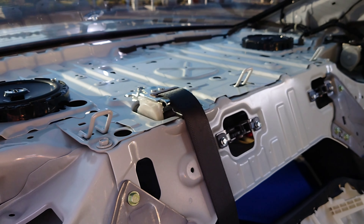I already showed you this in the first video — I bought this and use it as a glue. I apply it where the speaker is gonna lay down, then add more extra on top of the speaker. It's like a liquid rubber that gets really sticky and holds really strong. I'm gonna apply it on both brackets, add extra on top, wait for it to dry, then also add a little bit on this side where the speakers were. Then I'll just wait for this to dry and drop the speaker in, add extra glue around the sides, wait to dry, and install it back.